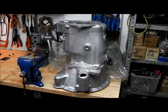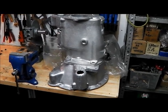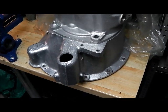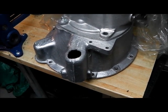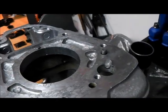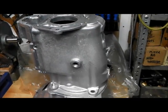Hello and welcome back to the workshop. Just a quick update before we start - all the gearbox assembly castings have now been degreased. Quite a bit of work to do yet - the sealing faces and so on all need a proper clean up. There's a hole that's been bashed in the bit where the clutch slave goes, presumably some mechanic had trouble with the clutch at some time and knocked a hole in it to put the pushrod back on. There are a few bits to clean up on the gasket faces and where bearings go - an afternoon's fettling with a file will sort that out.